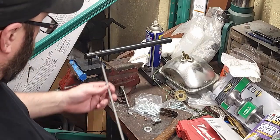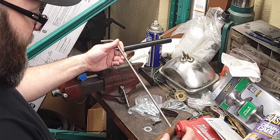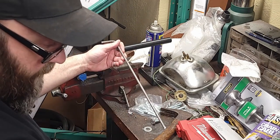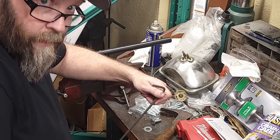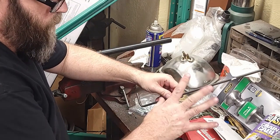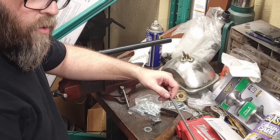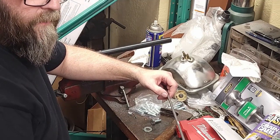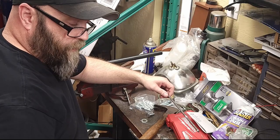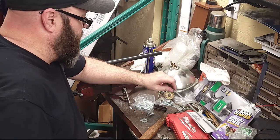So what we're doing this time, guys, is I did thread the end for that piece, and it's there for adjustability. But it said this is a quarter rod. If you thread it, you can thread it for quarter 20, which is the coarse, and quarter 28. 28's the fine thread. I went and bought for fine thread. It ain't fine enough. So I don't know if there's some kind of machine thread. I'm not versed well enough in it all.